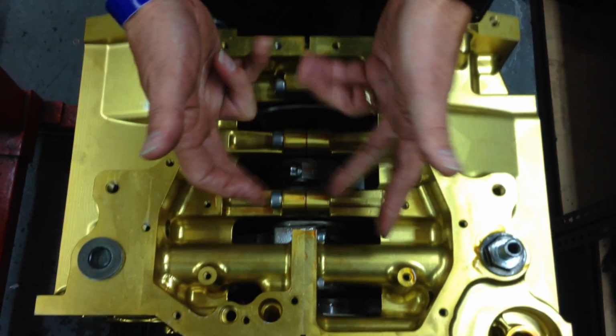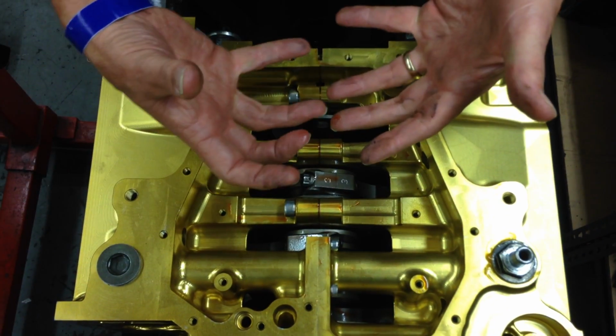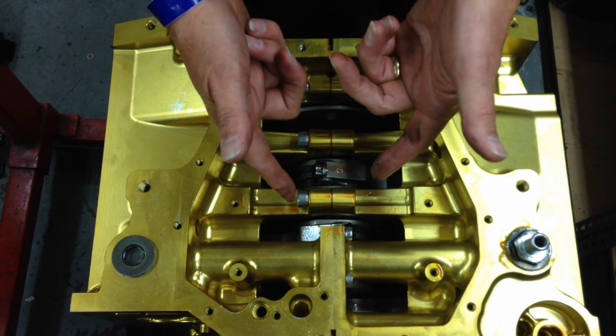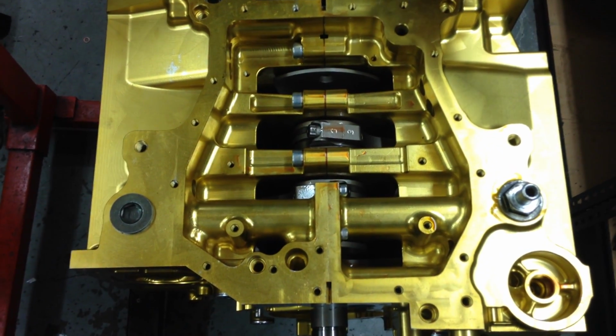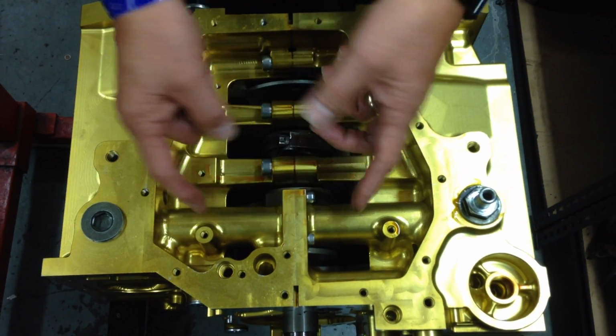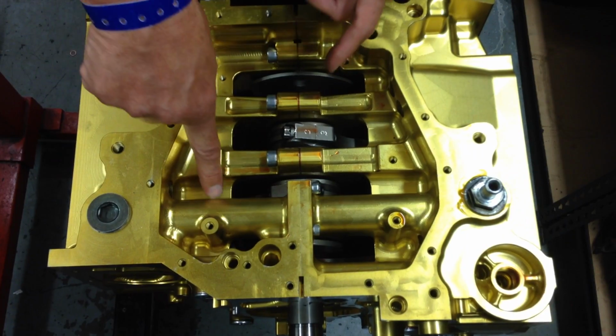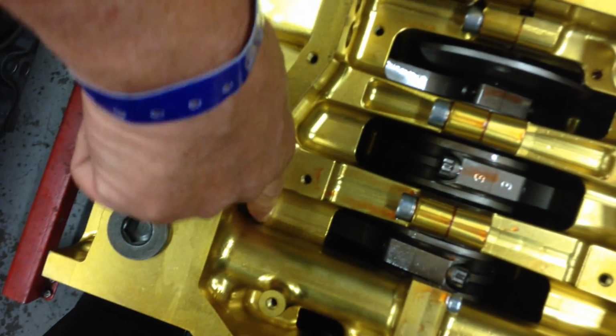And then just look at the billet block assembly. You can see there are additional locating bolts here to hold it all together, to give you more strength from a stiffness point of view. And of course that's not evident in the Subaru factory engine. And also this part here, which also increases the stiffness. The material goes down there, which is included material in the billet assembly, whereas in the Subaru engine, all under here is all hollow.